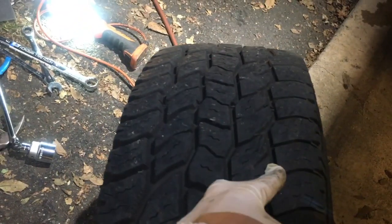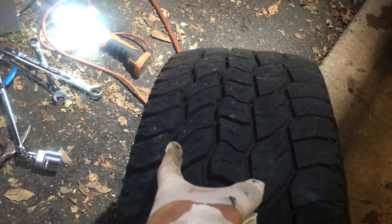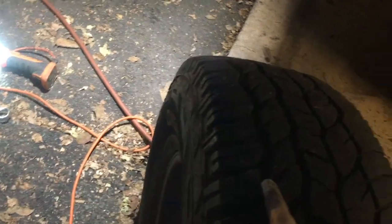Here's a tire — this side isn't very deep and this side is, because I have way too much positive camber on the truck. You can tell the difference between positive and negative camber: you've probably seen guys in little rice cars where the wheels slant in — that's negative camber. When they slant out, that's positive — not as common, you may see it on some old cars. Most cars are either dead center or with a little negative camber. I want to correct all the positive camber and bring it to at least zero, maybe a little negative, so my tires wear evenly. The Cooper Discoverers are about $180 a piece, so I don't want to blow through them too early.